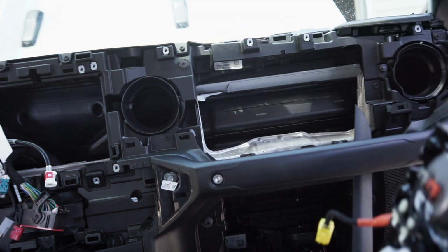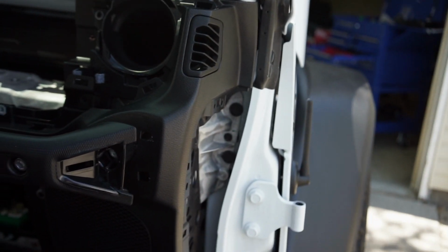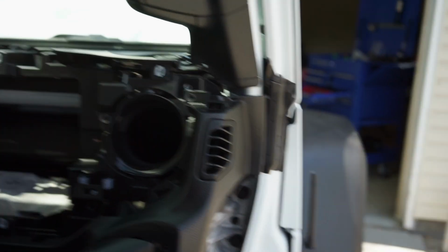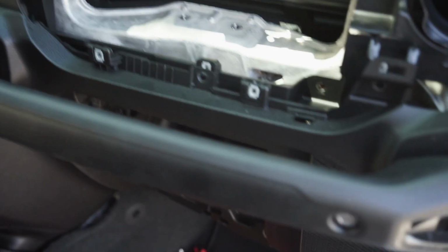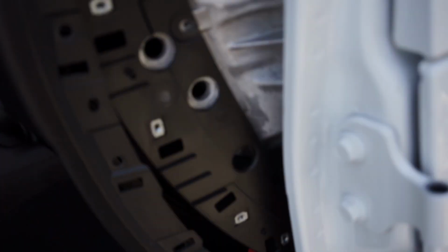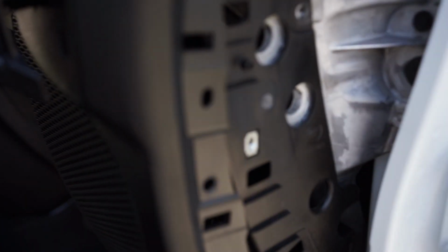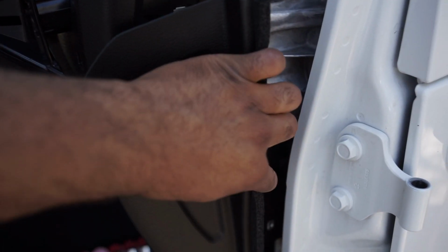and that'll get you your airbag and first panel. All right, so getting the front kick panel speaker out was a mission. I wanted to figure it out first before I record and try to tell you how to do it, and I did. So, ow, I just hit my head. So there's a ton of Phillips head screws. You have here, here, one here, I think there's one here, yeah, one there, and then on this side by the door, focus, you got to take this panel off, which is this right here. It just pops off with clips.